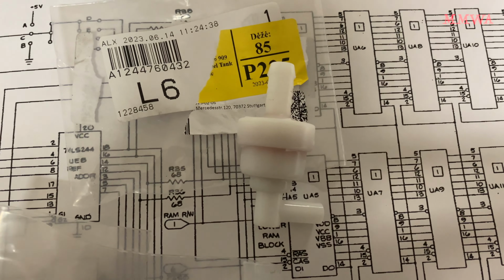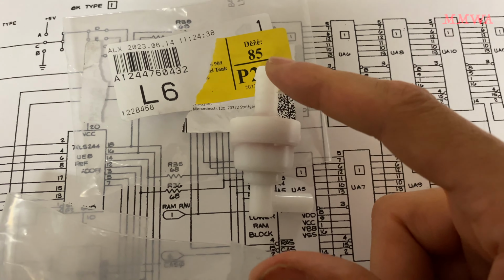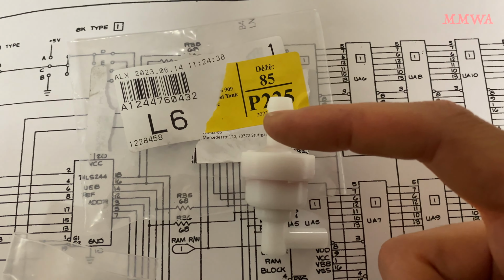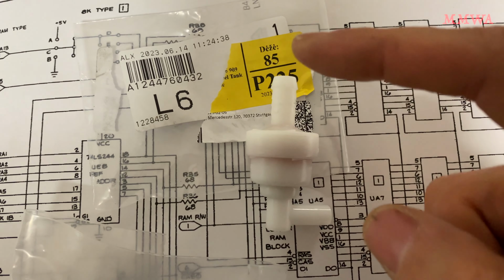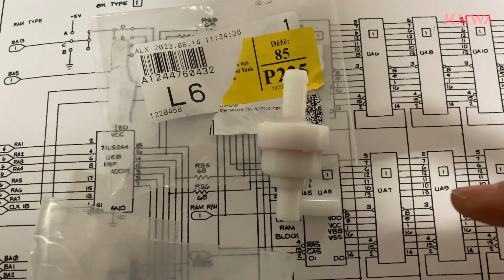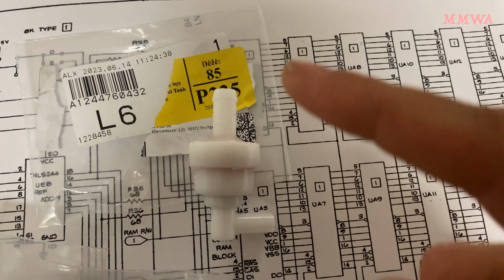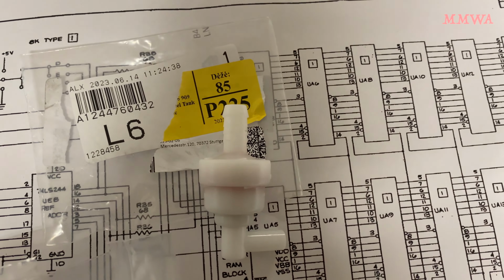The easiest way to test them is with your mouth. It should be quite difficult to blow in that direction. And if you simulate a vacuum in the fuel tank, it should be very easy to release that vacuum through the valve. So hard to push air in that direction to allow the tank to pressurize. Easy for the vacuum to get released from the tank. So easy to suck in that direction, difficult to blow in that direction.